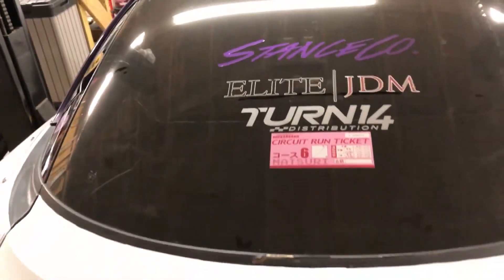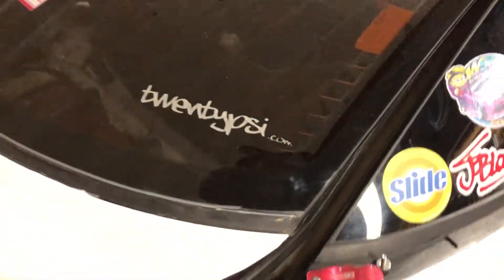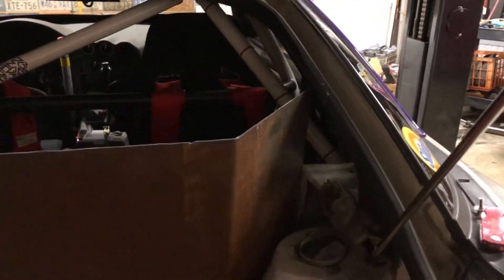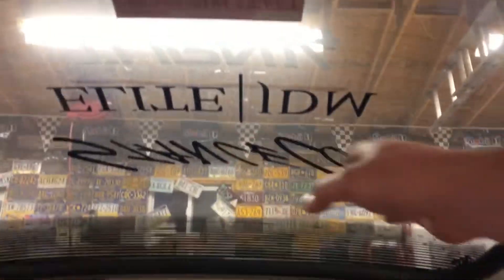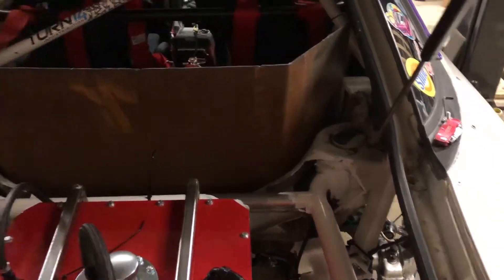It's Wednesday night, next night. We didn't do a whole lot last night — well, Pauly did. He marked out stuff and then cut stuff today in cardboard. First piece of the firewall is laid in like so. Basically how we're going to do it is we're going to make little triangle winglets to block this section off out of thin sheet aluminum. This is the thicker piece of steel that we just bent, and we're going to have a third piece that will rivet on here and go up to seal across the window — probably just a couple inches tall. That's pretty much how the firewall is going to look.